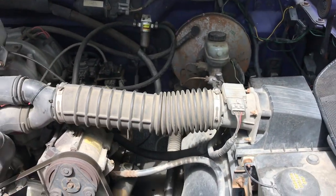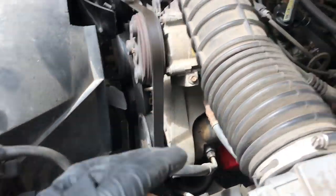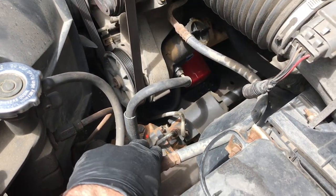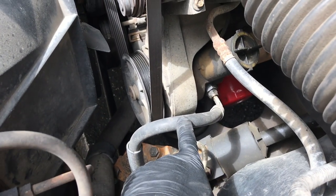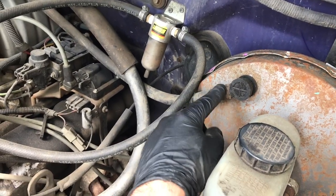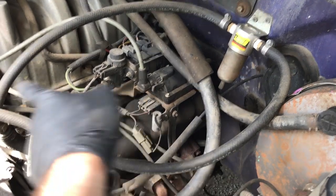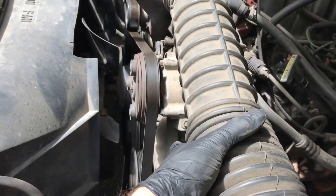I've elected to begin on this side. On this side you're going to see your air conditioning hose that feeds to the back of the compressor. You've also got one right here that comes off your AC — disconnect your two AC lines right down here. You have your power steering hose — disconnect that. Then come over here and you have this vacuum line that goes to your brake booster — undo that. I added this vent that goes to the oil filter — just undo that too.